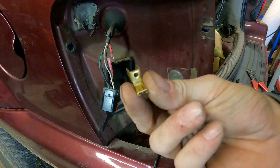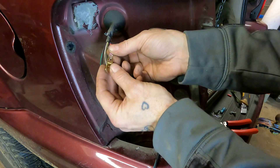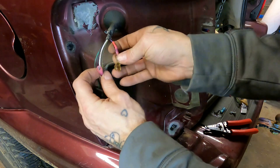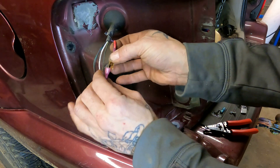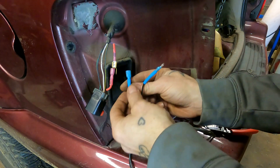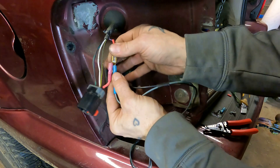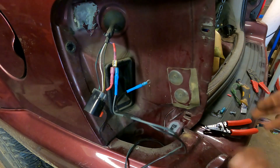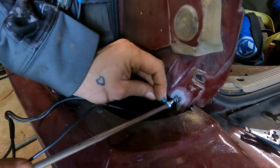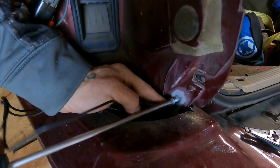Now like I told you before, this is the key to the whole thing. What this allows you to do is plug into the male blade connector and then branch off two different lights. So we've got our factory tail light harness there and our LED backup light bumper-mounted right there. We'll take our self-tapper and work it through — and there we go, light kicks right on. Beautiful, love to see it.